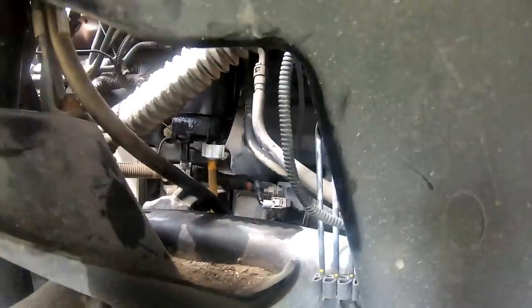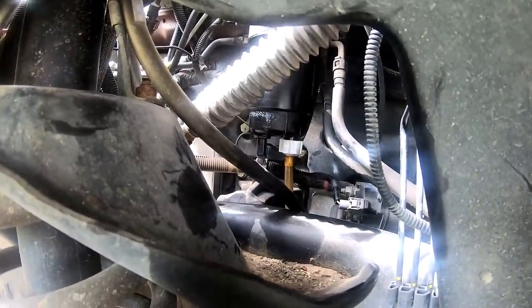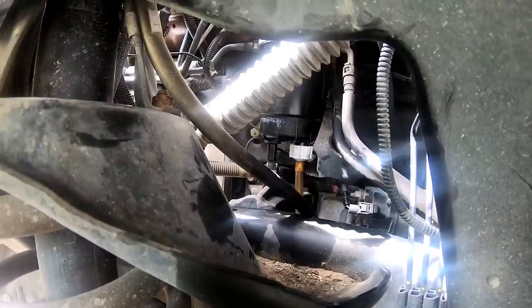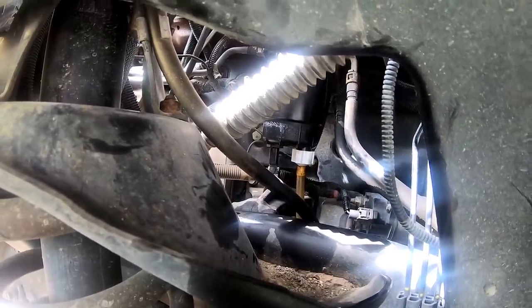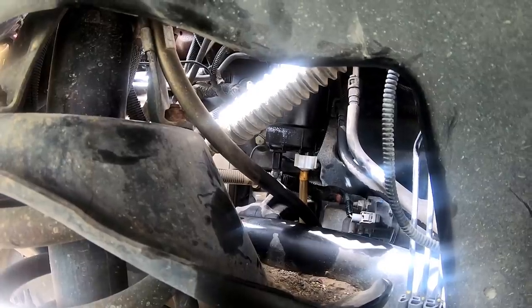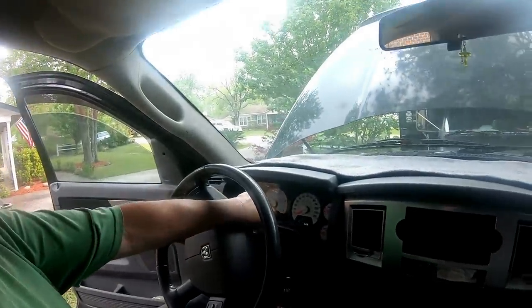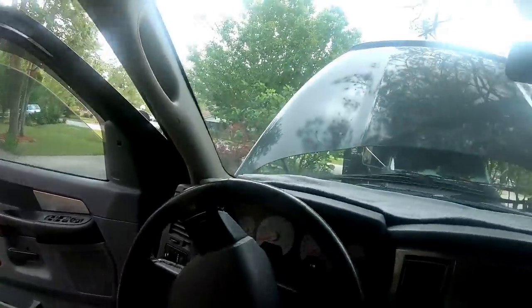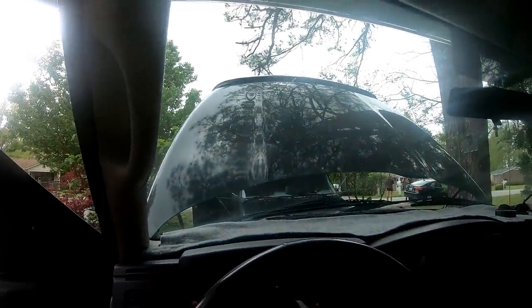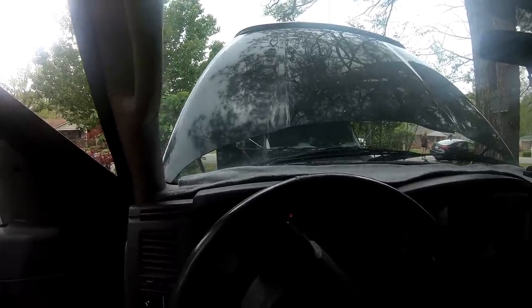I have the filter reinstalled — you can see it's turned to pretty much the same position it was before. I have my water sensor hooked back up and my tube back on. What I'm going to do is rotate the engine for just a split second, leave the ignition on for about 10 to 20 seconds, and do that three times — then she should fire right up. Let's hope it works. I've marked down my mileage so I know about the filter. Got her in neutral, depress the clutch, and roll it over for just a little bit, leaving it on for a few seconds while the pump picks up.